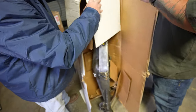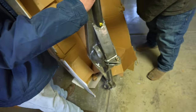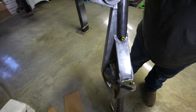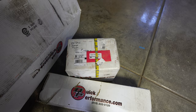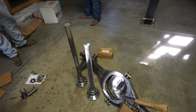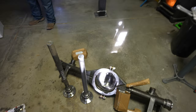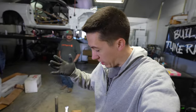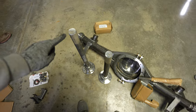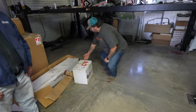There it is! See how many things come with your rear end housing. There's the housing - we have axles and then the rear center section. I went ahead and pulled the axles out as part of the upgrade to go to full 40-spline stuff, a little bit stronger. I told the guys about 1,800 horsepower and they said you might want to upgrade from 35 spline, so that was another reason to go with a whole new setup - new axles and a new center section.